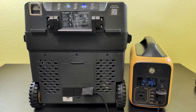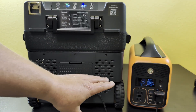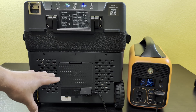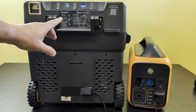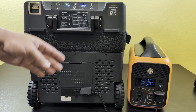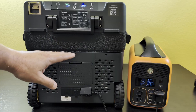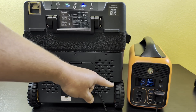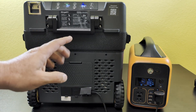Now I want to put this in eco mode and see if that makes any difference. I've watched it on eco mode for a bit, and what I've noticed is it will run at around 30 watts when running, then drop down to like 3 watts. I think what eco mode does is it doesn't keep everything running all the time — it turns it on and off to save power. In max mode the lowest it gets is about 25 watts, keeping things running to maintain the set temperatures. Eco mode allows the temperature to vary just a little, and I've seen it drop to 3 watts and just sit there because the temperatures were already where they needed to be.